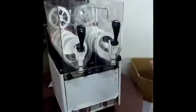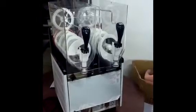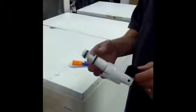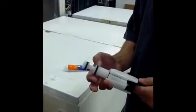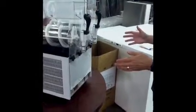The critical part of maintenance on this is the white rubber bell seal every 3 months, and the round bevel-edged evaporator seal every 6 months. If you neglect to put the lubricant on the O-rings, what will happen is they will split and cause the product to leak. The clearance is essential so that the system will operate correctly.